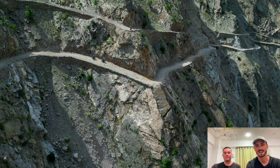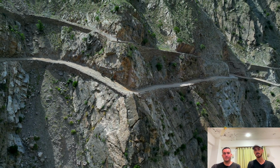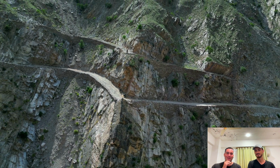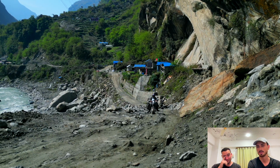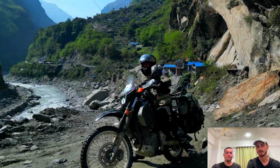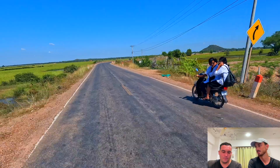Sprocket. Okay, so on our trip, we're doing a lot of off-roading, a lot of steep stuff, especially. Which you wouldn't have seen yet on the YouTube videos, but they're coming. If you're not a professional rider, having lower gearing is going to help you a lot. You're going to be using the clutch less. You're going to feel like you have more control of the bike, and it's going to be easy to ride.